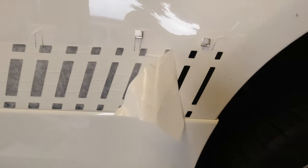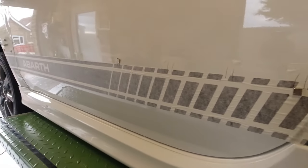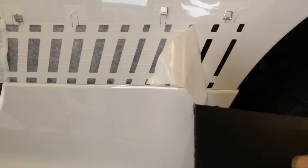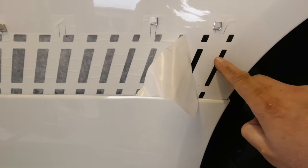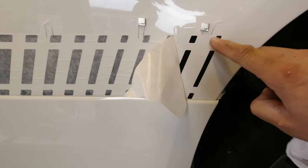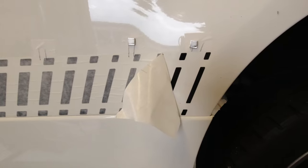Then we sprayed the back with soapy water to basically dissolve the adhesive that's attaching the transfer paper to the sticker just a little. See, this is falling off, but you'll have to peel most of it. That's unusual. And once it's off, you will have to go over it with, again, a little squeegee wrapped in a piece of rag or a silicone squeegee, just to make sure it's well pushed down and you've squeezed out any air and any water that's trapped behind each of the little elements.